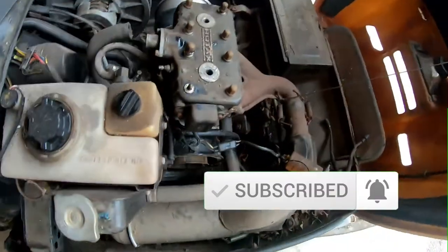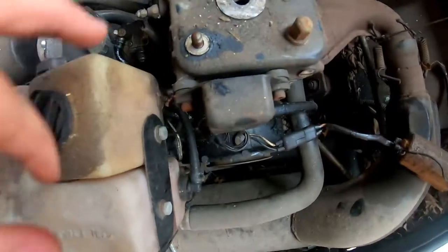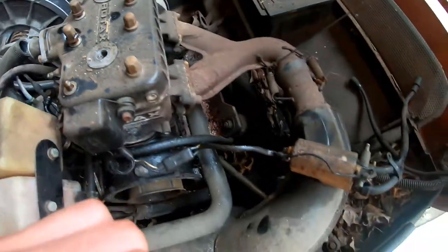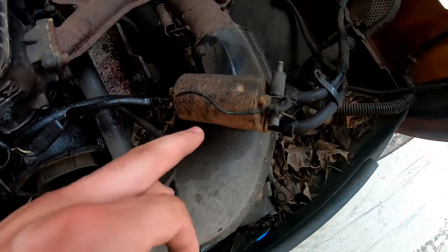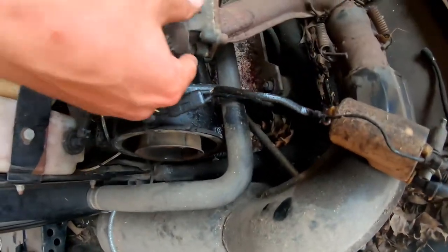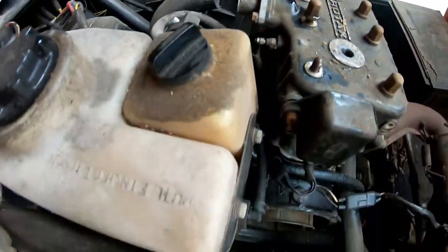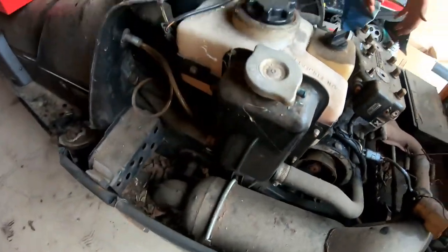I'm very, very skeptical right now, guys. If you can see here, there's a head stud missing. Head nut. And this may or may not be a coil laying over here. It's mounted on the side, the coil, guys. The spacer's here, there. And they had this coolant hose, so I'm guessing they had the head off for some reason. It could have a burnt piston or two.